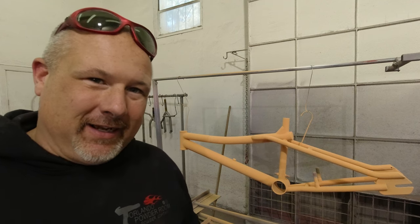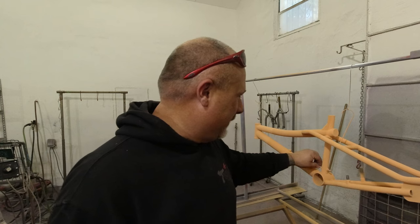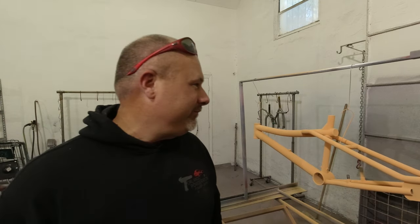We're going to put another coat on and try to darken it up a little bit. We're just playing at this point — we gave it another heavy coat. We're probably going to start seeing some picture framing and stuff that candies do when it starts getting thick and weird. So we're just going to put it in the oven and see how it comes out. Right now it's got two coats of chrome, a coat of the candy dark translucent orange, and a really heavy coat of dark translucent orange, because it was not even dark. You could still see through it like crazy. I've seen this happen with one other color called Grassy Gold, and it is a nightmare.